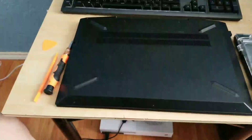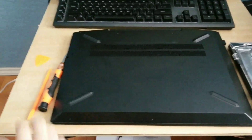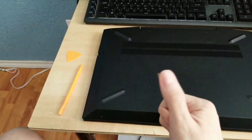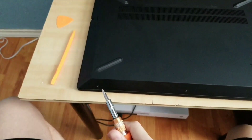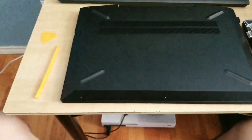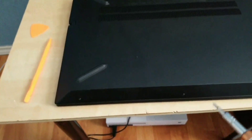Here's how to open this laptop. It's fairly simple — you just need a 2.5 millimeter Phillips screwdriver. You have seven screws total: three down here on the bottom and four up here on the top. It's a bit hard to hold my camera and unscrew at the same time, but I'll try my best.